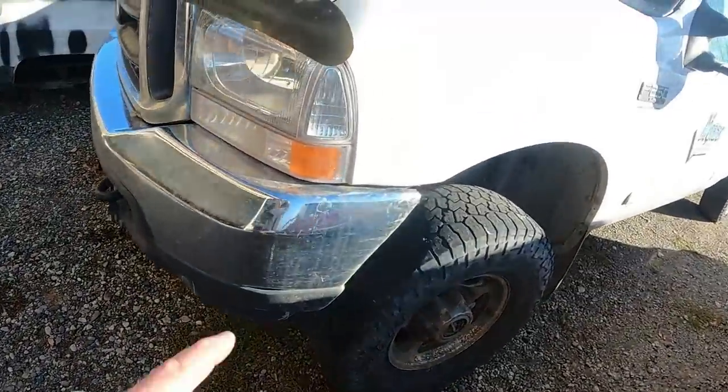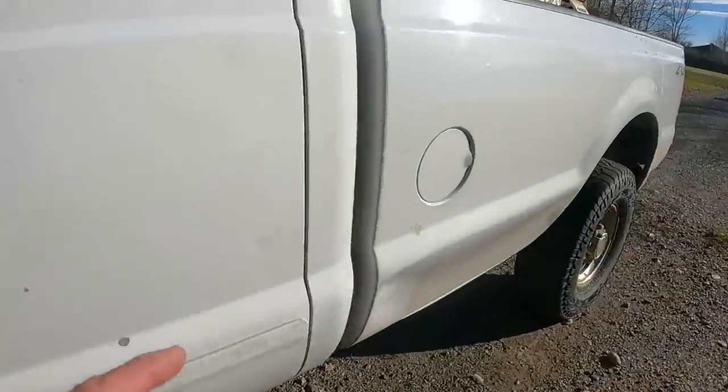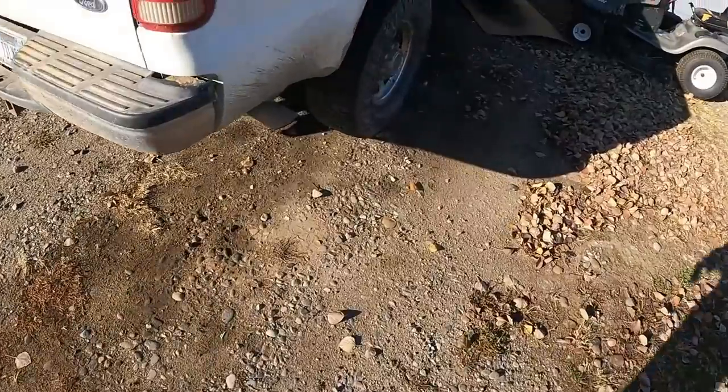For people that haven't seen the other videos, the F-250 Power Stroke with the 7.3 diesel has over 420,000 miles on it — 423,000 or something. It's been a great truck. But this thing has always, always been leaking oil. Every time I fix an oil leak, I get like two or three days with no oil puddle under the truck and then boom, there's another one. I've had several of the high pressure oil lines leaking, I had the oil cooler leak, and as soon as I fixed that it started leaking from up by the timing cover area.